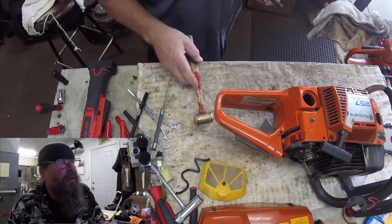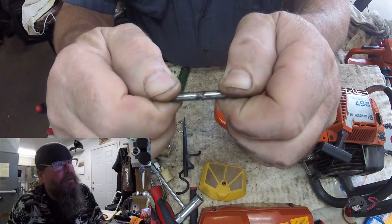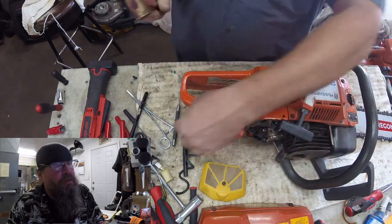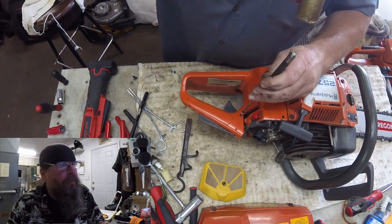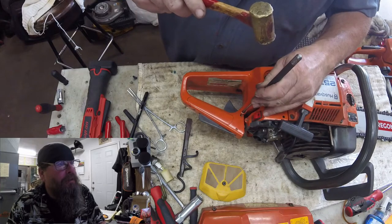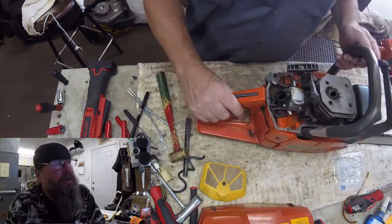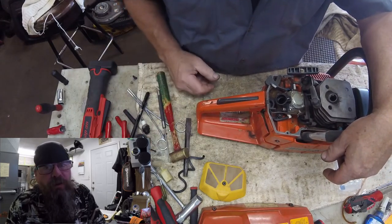I'm simulating in the vise what I'm going to do — I knurled the center of that pin by just hitting it with a chisel to raise some edges and fatten it up. Then we're just going to tap it into place so that it locks into the gray trigger and pivots on the orange handle. It's just one of those 'do what you gotta do, get it done' repairs. There are twenty different punches in the toolbox just a couple feet away, but I insist on using the one I got in my hand. Anyway, we got the trigger repaired.